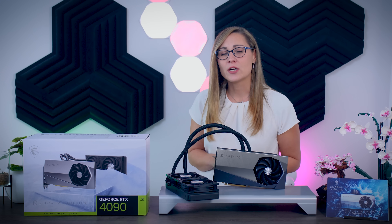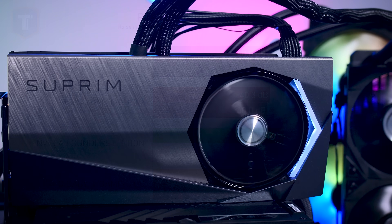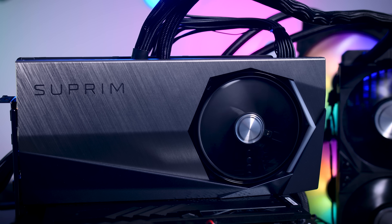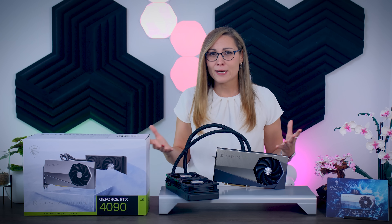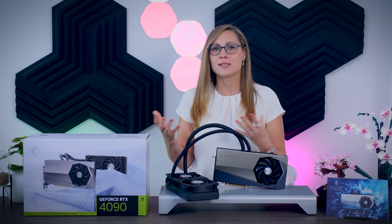The noise level of this card has a much bigger impact. With a result of around 40 dB in both BIOS settings — measured at 50 cm distance from both the main fan and the radiator fans — it is noticeably quieter than the Founders Edition and the Gigabyte Gaming OC, and pretty much on par with the air-cooled ROG Strix. The difference in noise between the two BIOS settings was a bit small; the fan speed did drop in the silent profile, but the overall noise didn't sound that different — though both profiles are silent enough.